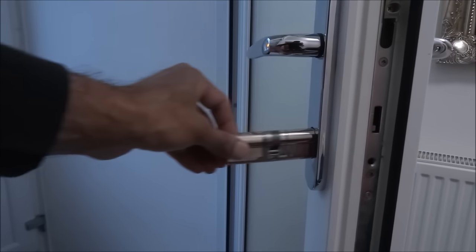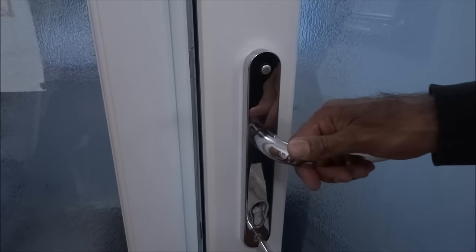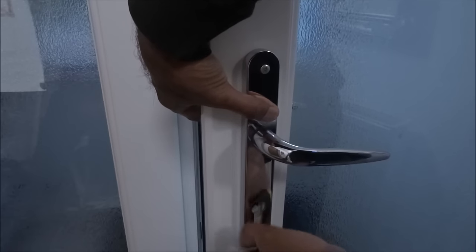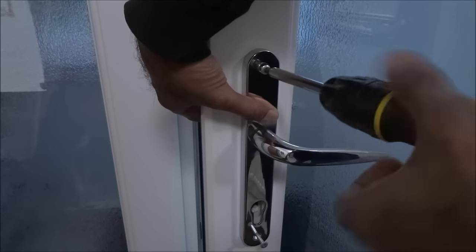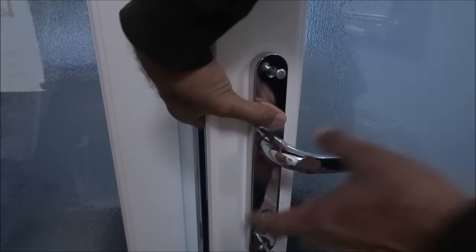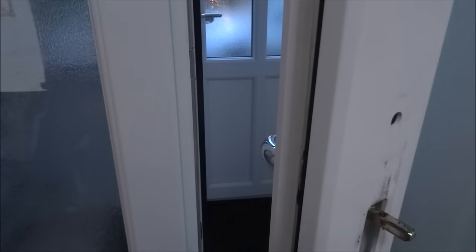What we're going to have to do is take the handle off. There are two screws on the inside — let me loosen them. Loosen the other one as well; just be aware the handle could just pop off. Hold on to it — that screws off. The second one's off now, so I'll carefully hold on to it, pull off one end, then go around the other side and remove that handle.